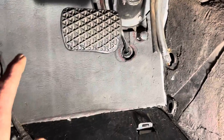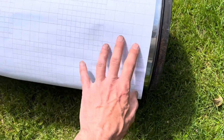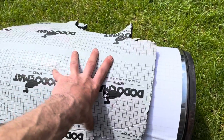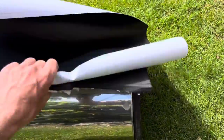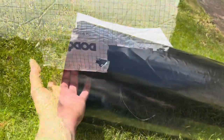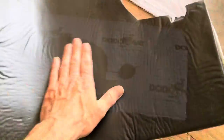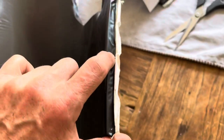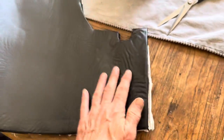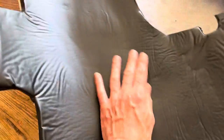You can see that all fits nicely in there — that'll look nice once we've covered it with the black vinyl. Once again I'm going to put the vinyl around the bin, take the sticky backing off, and then put this on top of the sticky vinyl, and when you turn the whole thing round and stretch it out the vinyl won't have any creases in it. Just taking the plastic backing off here. It should just be a matter of laying this on — we'll just cut off the excess and then trim it down neatly. Next up we're just going to make little cuts so we can fold this over and then trim it. That's not perfect but that's pretty darn good. What I've done is cut these edges long, then looped them over and stuck them onto the sticky back, and I'm not going to actually stick it to the footwell because I know from experience once you stick that on you'll never get it off again without ripping all the foam.